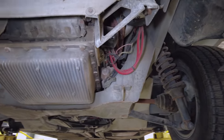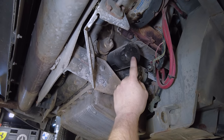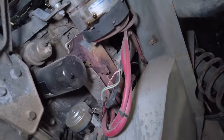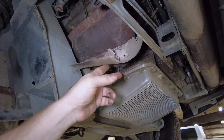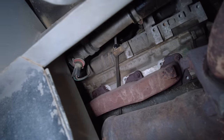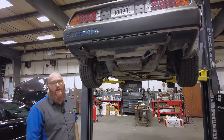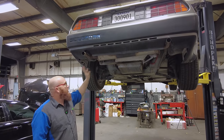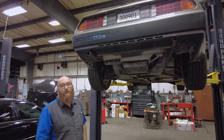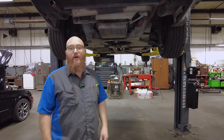And here is our venerable PRV V6. This is the oil pan. Luckily, it's easy to get to things — there's the starter, there's an oil filter, there's an oil pressure sensor, our alternator, there's our exhaust manifold. On this side, this is actually a catalytic converter — you can see some of the shielding is coming off from the heat insulation. Up above is some more coolant pipes. There's the cylinder head. Really not hard to work on, they're just strange. Here is the muffler. On Hoovie's Garage when we had his DeLorean in — and actually on a couple others — we've put stainless steel headers and also stainless steel exhaust, and it sounds really, really good.